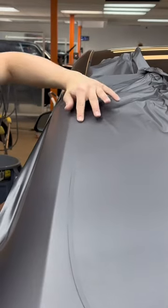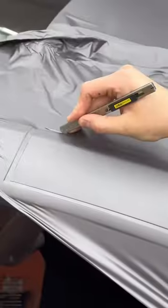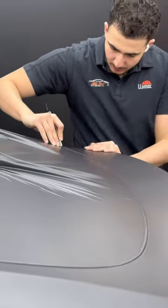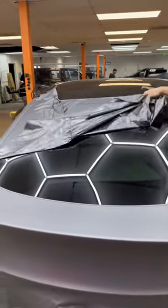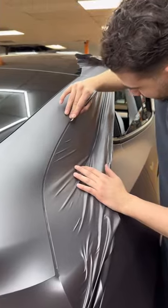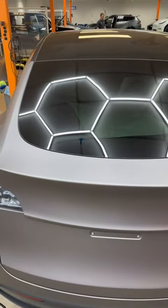You will need plenty of heat and you want to stretch the top back into the middle. Because the middle is getting cut out, it doesn't matter if you have a whole bunch of bunched up material because that's just going to get cut out and ripped off. Before cutting, make sure to post heat so that way you don't have any material failure,